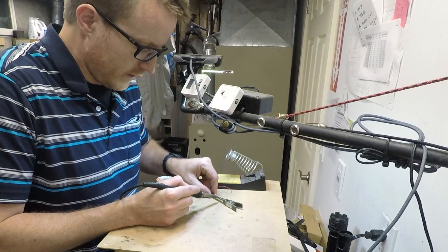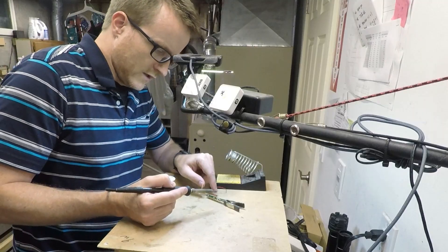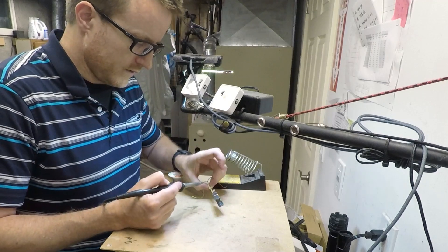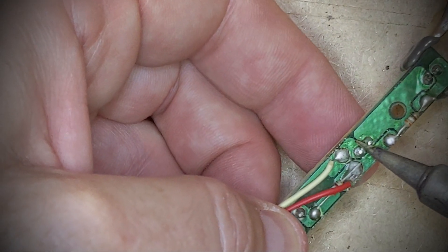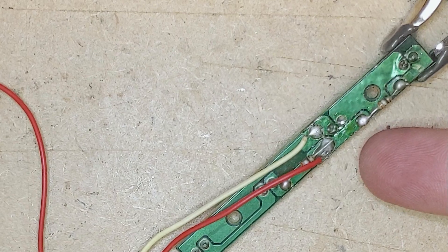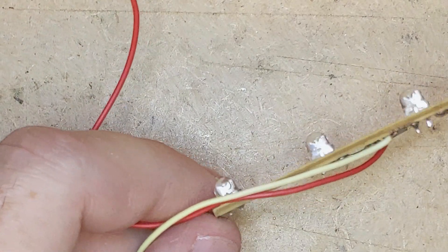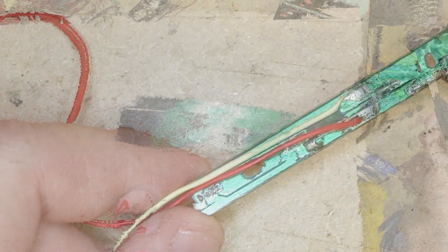Although this is not an approved way of getting rid of excess solder, it does work in a pinch. The only thing is it can also pop out the connection that you were trying to do — and if you accidentally knock out a part like we did there, just apply light pressure and it's back in place. That right there is a fair example of what you're looking for in a good, well-reflowed solder joint. It's relatively shiny, it has a nice little fillet to it, it doesn't have too much solder balled up on top, but it also doesn't have too little.